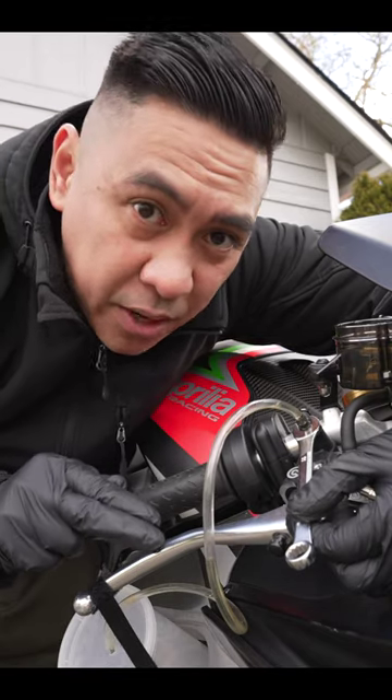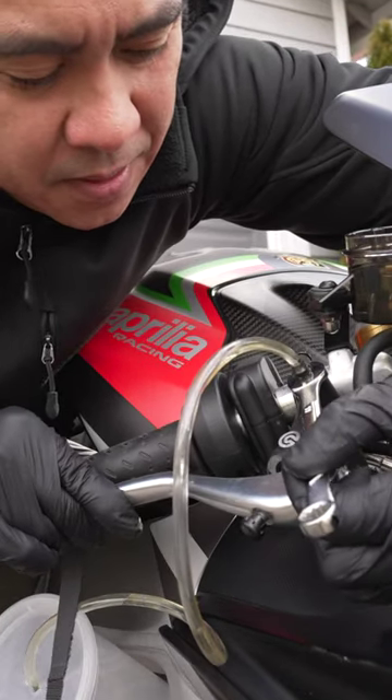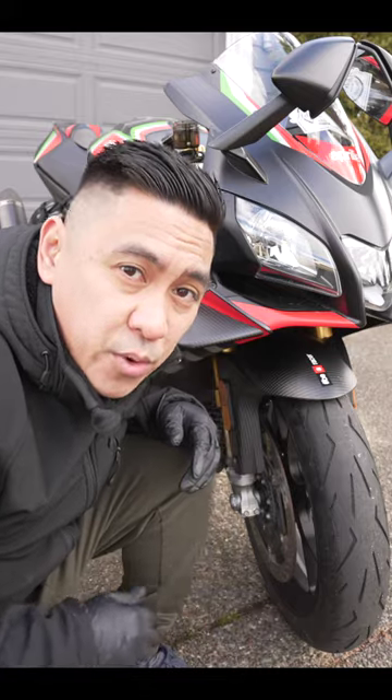When you finally start seeing clear brake fluid, do the same thing one more time — pull in the brake lever, loosen the nut, get some fluid out, then torque down that bleeder valve and top off your reservoir. Now repeat these steps with each brake caliper.